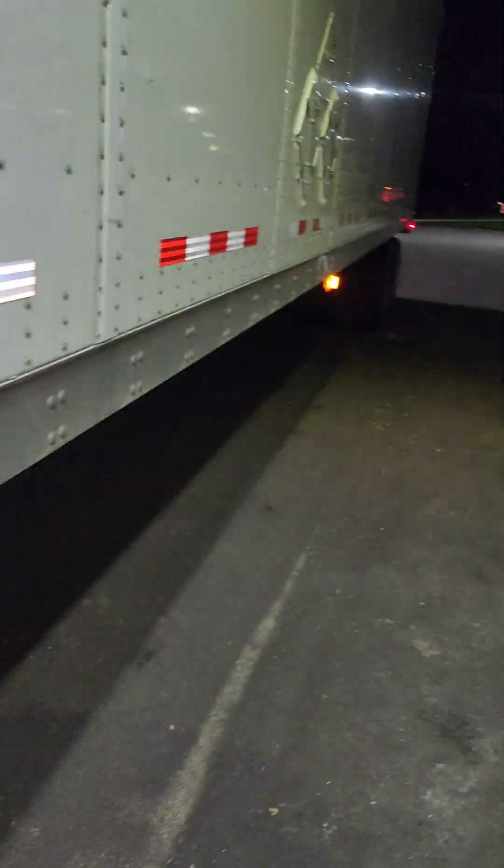So every single axle, I take the time and I look at them and try to inspect them. This way, for the next 300 miles I'm going to drive, I'm going to feel secure, I'm going to feel safe, that I know the tractor is doing well. Same as well, we're going to look underneath it, make sure there's no leaks. Shocks are present, I don't see them loose or anything. The airbags are not leaking. I'm not hearing any hissing sound, which is what I mean when I say they're not leaking.